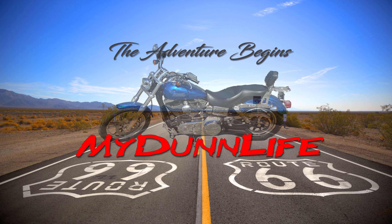If you've never done this — if it's available in your area and you happen to park your bike for the winter or for months at a time — if you can find non-ethanol fuel, it's sometimes referred to as marine fuel in some places, because they're not allowed to use it on certain bodies of water since ethanol is a marine pollutant. It will absorb moisture, which causes condensation in your tank and in your fuel. That's why ethanol fuel does not last as long as non-ethanol.